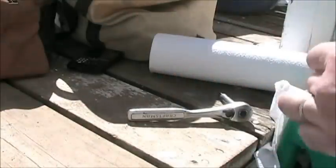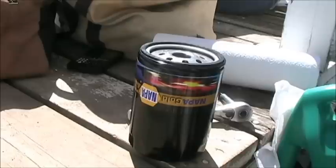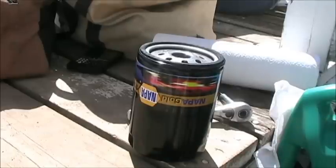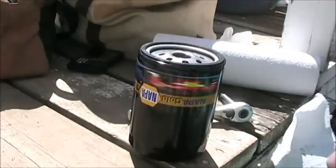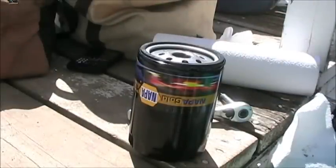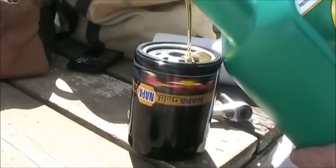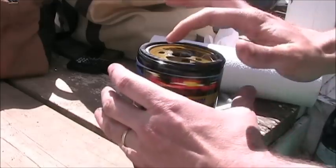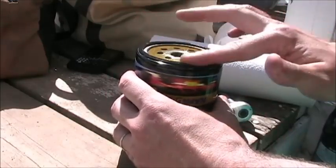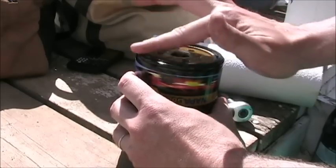The reason I brought you up here is because we want to pre-fill our oil filter. All the time spent with the filter filling up inside the truck is time the engine isn't getting oil, so we want to pre-fill it. I'm going to pour the oil in and then we'll go back under the truck. You'll also want to put a little oil around the rubber ring on the edge — this will help it seat properly and won't rub the ring off when installing.